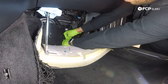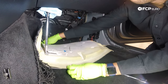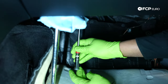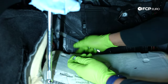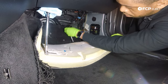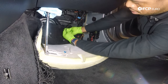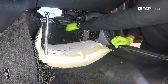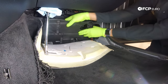There are two nuts in here and right about here, which you're going to be able to feel. I'd recommend a deep socket 10mm because the nut sits on a stud — that's just going to make sure you have enough depth. While I'm removing the nut, I have a finger putting light pressure on the side of the flange so the flange stays put and the nut still turns. That way you're not going to lose it in a cavity down there. Even if it slips off your finger, the moment you remove this panel you'll easily be able to fish it out. The last one is pretty easy to see and crack loose.